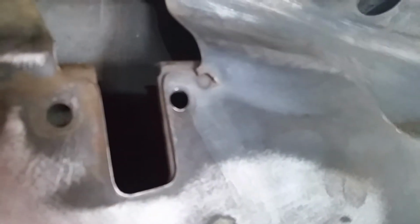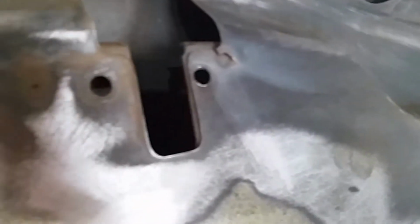But I think I might have to weld a little bit because I can't see it. Right there. Looks like we've got a crack. I just don't trust it. Looks like it cracked right on the spot weld. So buzz that with the welder and then I'll be a little happier. But a lot to do.